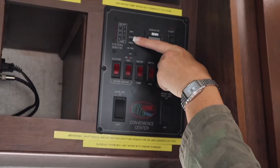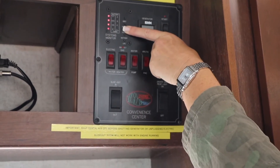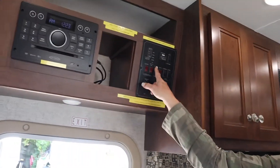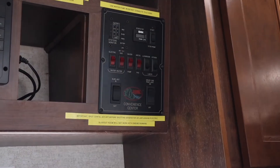Then you have fresh water - if you hit 'fresh water' it'll tell you how much fresh water capacity you have in that storage tank. When we're connected to a garden hose, we do not use a water pump. You notice this water pump button right here? It's similar to a boat - it's going to pump water out of that storage compartment through your sink faucets, shower faucets, and toilet. When you're connected to a garden hose, we don't use a water pump. We're only using that if you're out in the middle of nowhere - once you're hooked to a garden hose, you're going to get the pressure from their source.